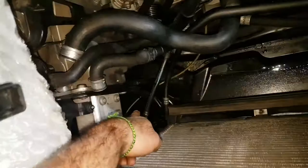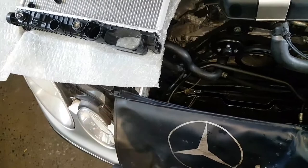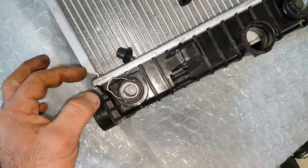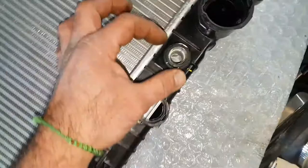Now there's the matter of the transmission line installation, but first we'll talk about removal. The transmission lines are quite short and they're held on here — even if it's a CLK compressor, whatever. You might need to loosen the bolt, especially if things have been bent or the car's been crashed, or if the hoses have shrunk. There's sometimes a lot of tension on the hoses and you don't want that on installation. When removing the transmission hoses, once you lift the clip, they're not going to come off easily if they haven't been touched for years. Spray silicone, be patient, but I do find that removing the clip altogether helps.